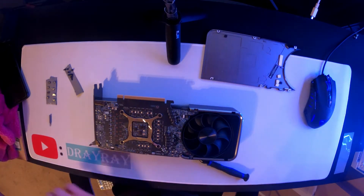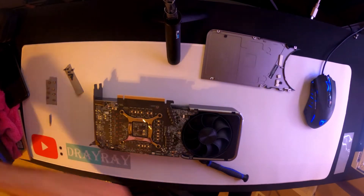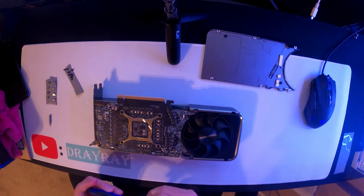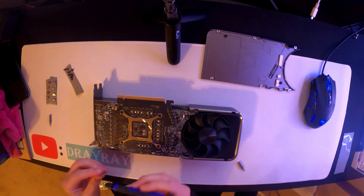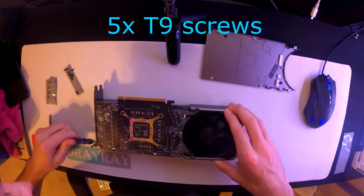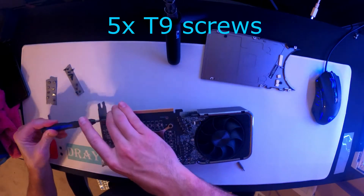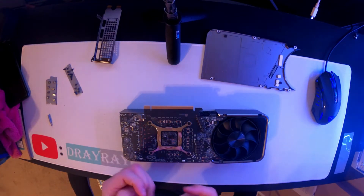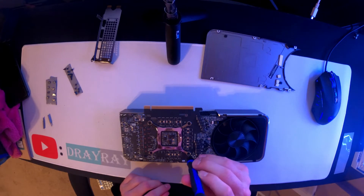This is going to be a Torx 9 — actually Torx 6. We'll get a Torx 9 as well because we have to take the plate off the back. The little plate comes off; set that aside with the screws. Then we'll change to a T5 and get these screws out.